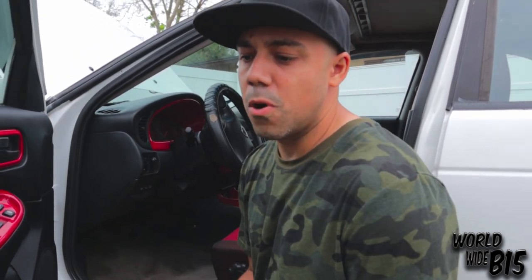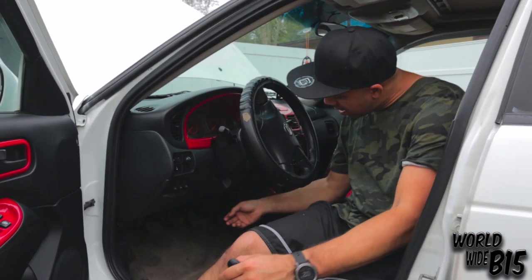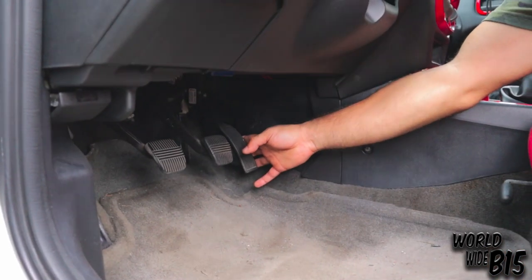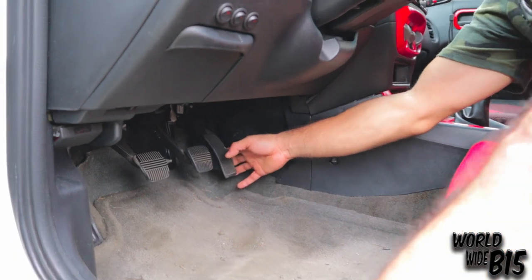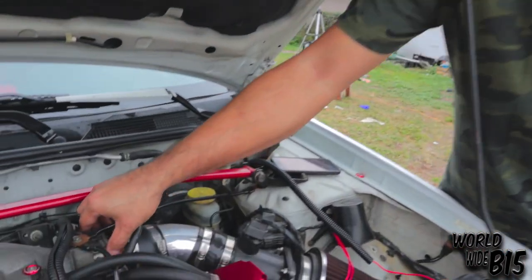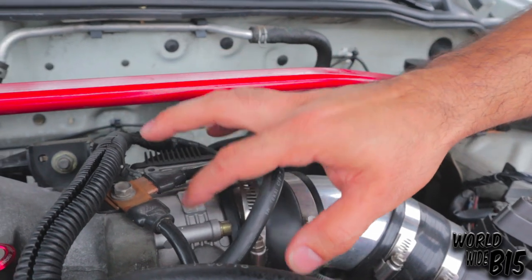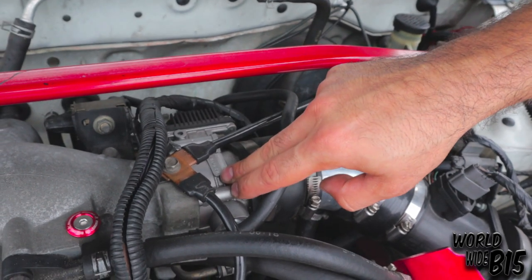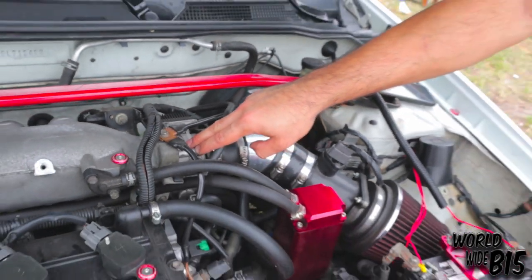You can pair it to your phone and open up the Torque app. One of the things I had to buy when I first got the car was the pedal accelerator sensor. It's pretty much this pedal here — it's got the sensor built in. I was having problems with that and the RPM, so that fixed it. Paired with the Hitachi throttle body — I had to buy that and change it when I first got the car, due to the RPMs fluctuating and going all crazy.